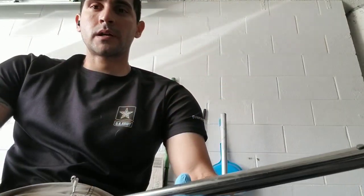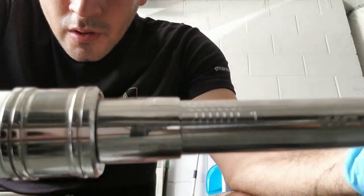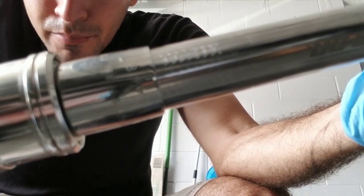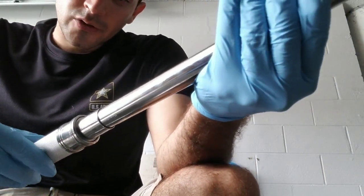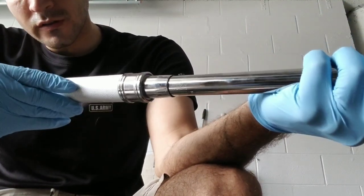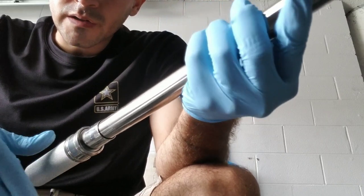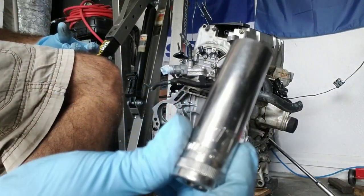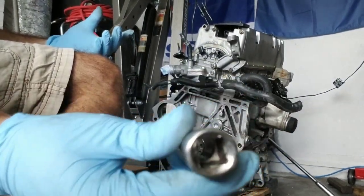All right, so I got my torque wrench here. I have it set to 87 foot-pounds of torque. That's what the manual or the page calls for, which is going off OEM standards. So I hope this is ready to go. So we're gonna be using a 17 millimeter. This is a 12 point. This is the only one that I have that's a half.